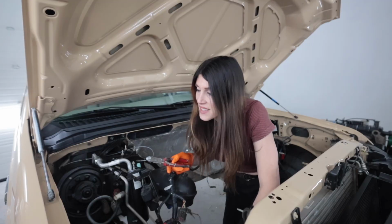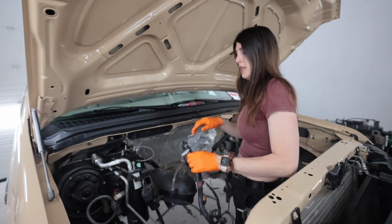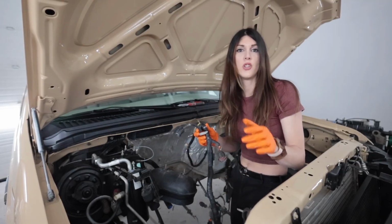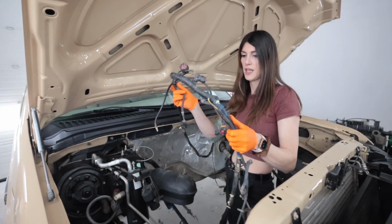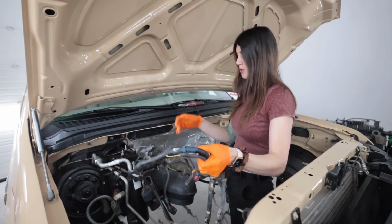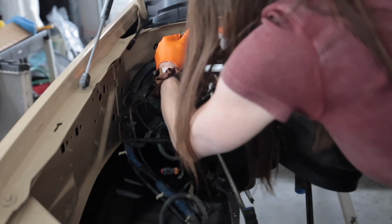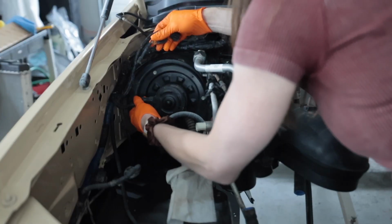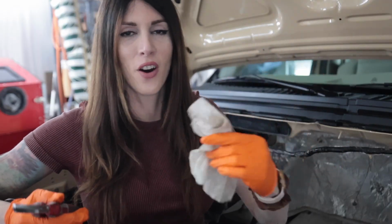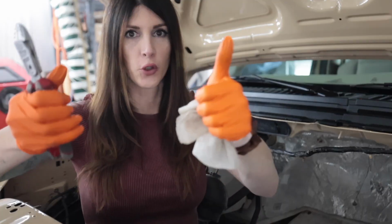So pretty much the last thing I gotta do before this truck is out of my possession is route the engine harness to where it goes, because all this stuff, regardless of the fact it's getting a Cummins, is still going to be utilized in its original position. Oh, this harness was so disgusting. So that goes like that. That one right there. It's kind of idiot proof where the harness goes throughout the engine bay, because there's holes all over the place for the little plastic Christmas trees, and it just kind of flows.